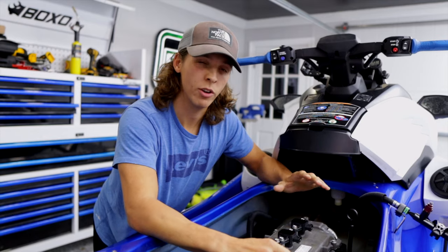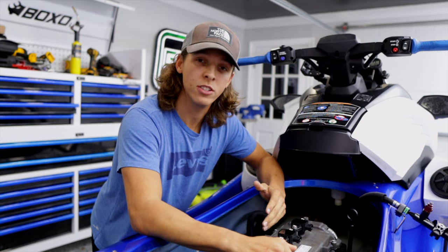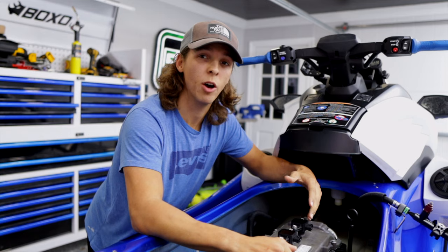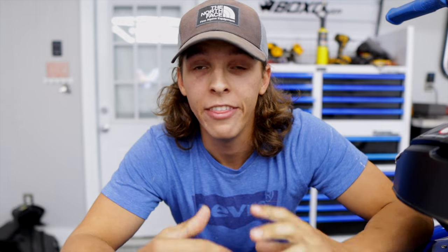We're going to be replacing that with a coolant line going directly to the engine block, and then blocking off the oil cooler where the exit water line would be. That's just about it as far as the exhaust side of the engine, other than the feed line going to the oil cooler that will now be coming off of the intercooler. This is all super easy to do, especially with the exhaust manifold off of the ski. The only tool you'll actually need to remove these old cooling lines is a set of pliers. I like to do all these installs with simple hand tools and only use power tools when absolutely necessary — that proves just about anyone can do this with a simple set of tools you have in your garage.